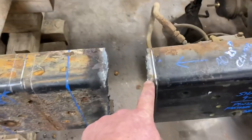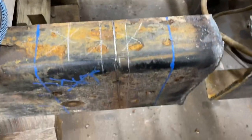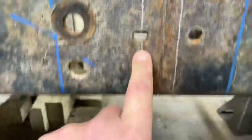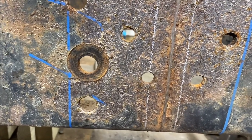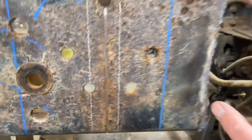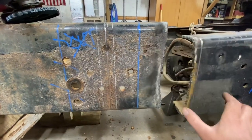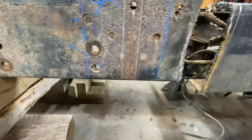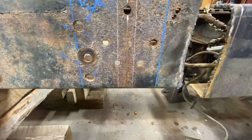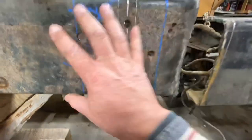And so what we came up with is we've got our mark on the frame cut on the Peterbilt. And you can see how many different iterations I came up with, remeasuring and retweaking. I also knocked out the old putty plugs that were in here, which I'm thinking were quarter fender brackets or something along those lines, because the old spring hanger was right here, so the front of the tire was back in here. I think those were quarter fender hangers that they filled with putty when they double framed it. I don't know, I'm guessing. I think the double frame was added when they made this into a wrecker. So anyway, I knocked those out.